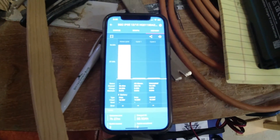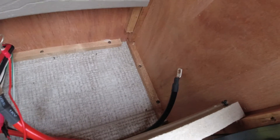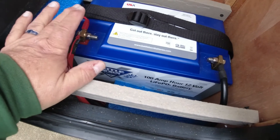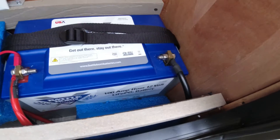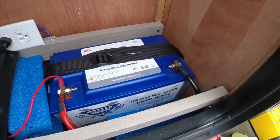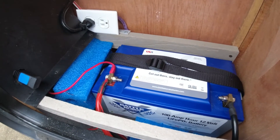I had to pull all my stuff out of the cargo area and pulled my bags off that were protecting my terminals from getting crossed up. We're going to bring it up here fully charged and hook it to the red terminal first, then the black terminal. I've got that all hooked back up again — positive first, then the negative. You'll get a little spark when you do the negative, so don't be alarmed, just get it on there and tighten it down. We've got our pool noodles back in front and on the side.